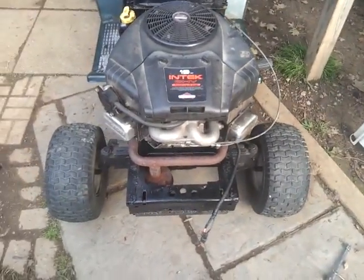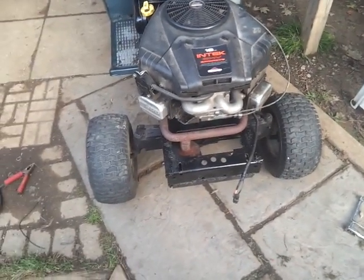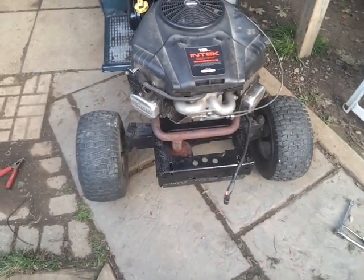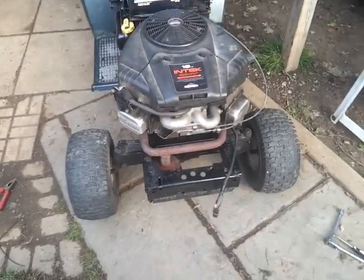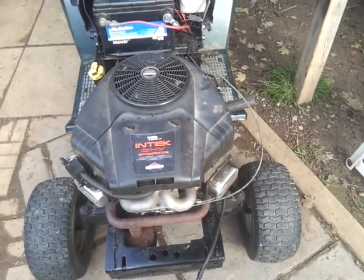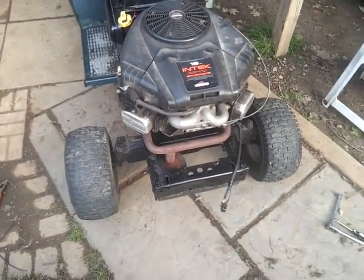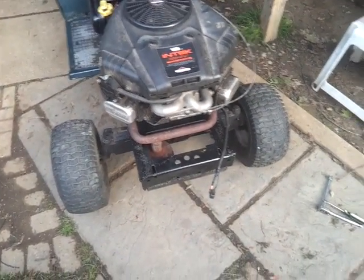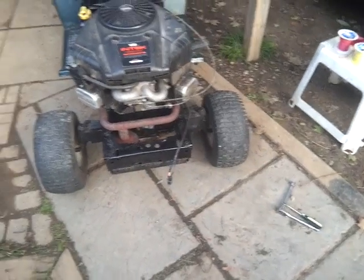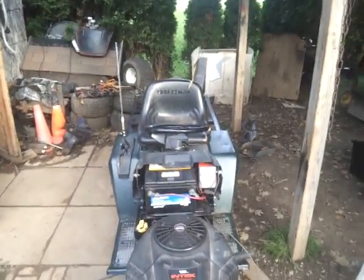The engine's going to need exhaust gaskets. Really, this engine needs all new gaskets, but it's not leaking oil too badly. It's mainly those exhaust gaskets are pretty bad. When I've had the intake off, the intake gaskets didn't look too bad, but there's oil leaking somewhere. I believe it's leaking out the sump somewhere. I'm not 100% sure on that though. But here it is. Next is a test drive, which I'll bring you guys on next week.